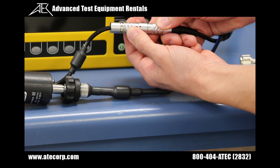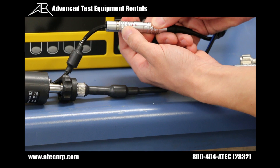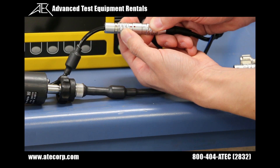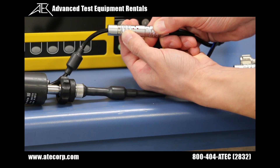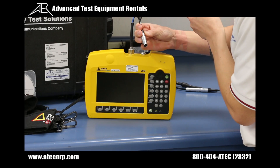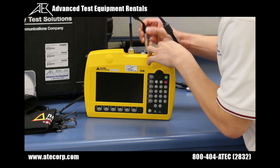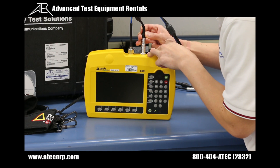When disconnecting the 12-pin male and female connector, you must be very careful to pull on the finger grip on the end of the male connector and then gently disconnect. Line the red dot up to the front of the 12-pin connector.